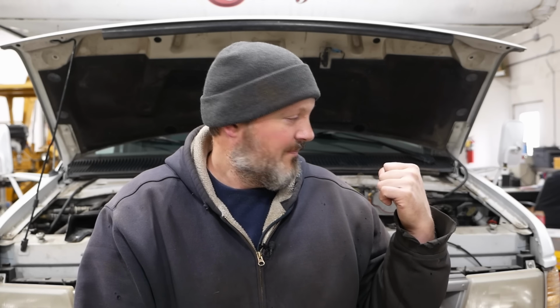I don't understand the O2 sensor. I don't really understand how that works at all. Like, how does the computer ever know whether it's rich or lean if it's using the secondary air injection system to just blast air right past that O2 sensor? I don't understand why it idles in open loop. I've seen other vehicles like that. Usually it's because the O2 sensor doesn't stay hot enough that it drops back into open loop. This one doesn't seem to ever even try to go into closed loop. So not sure what the criteria are for that.